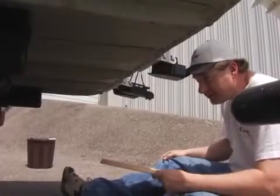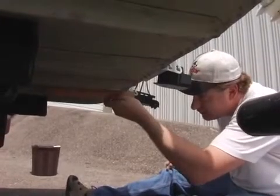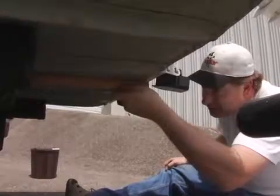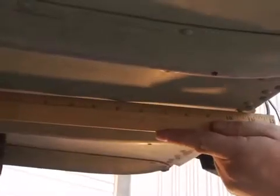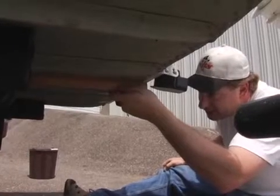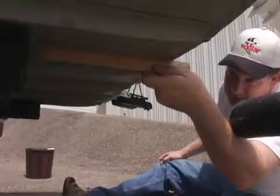You need to select an area of the hull that does not have a dent or depression that might create a pocket of air while the boat is running at higher speeds, so check carefully to find a good spot. A simple straight edge ruler can be used on the bottom of your hull to ensure you have selected a non-warped area. Simply hold the straight edge up to the boat like this to check your hull. We recommend you test different areas of the hull for the best installation location.